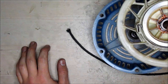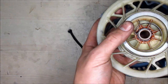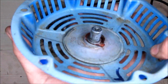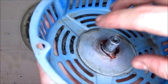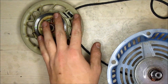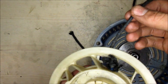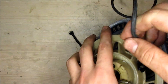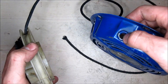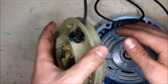Once your spring is back in, we can go ahead and put it back onto the shroud. In this particular model, this little U-bracket gets locked into this edge so it stops, and when you keep twisting it, it adds more tension and this wheel wants to spin. So you want to hold it as hard as you can. Don't let your rope get caught around the wheel, because it's eventually going to go inside the hole outside the shroud, and we don't want any knots tied up.